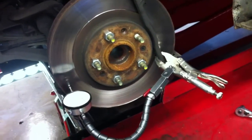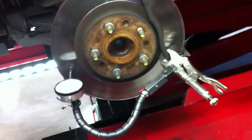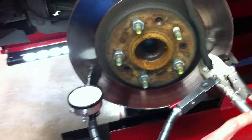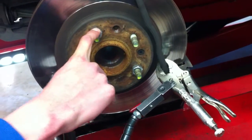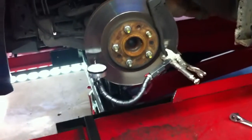That's how you perform a run-out on a 2005 Cadillac CTS. Make sure the bolts are tightened down when you do the run-out — ten foot-pounds. You want your vise grip close to your steering mechanism or to the knuckle. You want your rotor torqued down, you want your dial indicator preloaded, and you're ready to perform any kind of dial-indicating run-out procedure on any rotor possible.